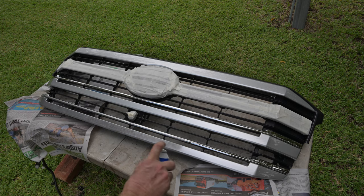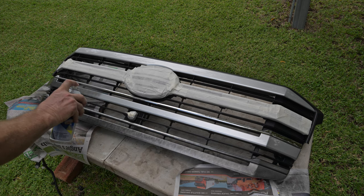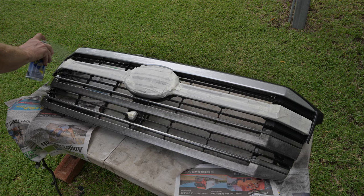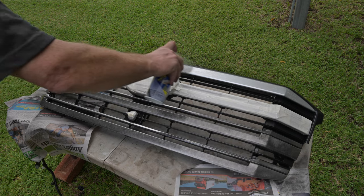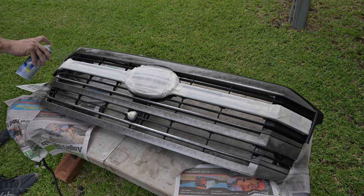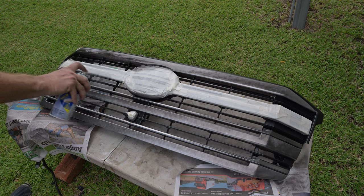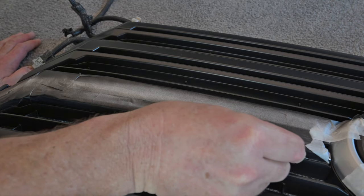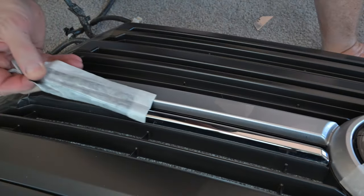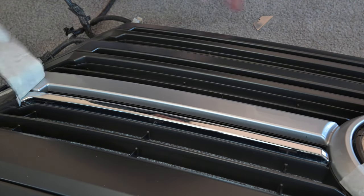While the grille's off I'm also going to be painting it, changing all but the centre pair of silver bars to matte black — these two bars align with the daytime running lights. I'm using Plasti-Dip for this process, which is a spray-on rubber coating. The benefit of using Plasti-Dip rather than paint is that it can be removed later if I change my mind. I'll provide a link on the website to find the Plasti-Dip and report on the durability as part of the regular updates on the build. Once you've applied at least four full coats, leave the grille to dry overnight, then run around the edges of the masking tape with a sharp blade and carefully peel off the tape.